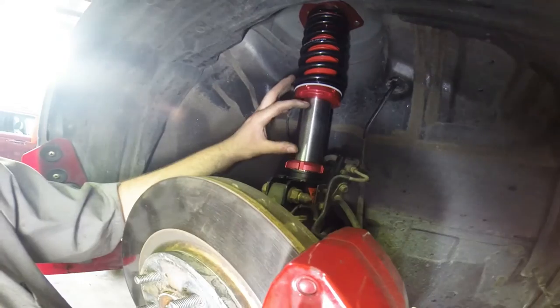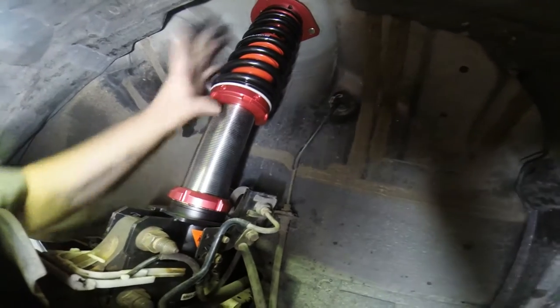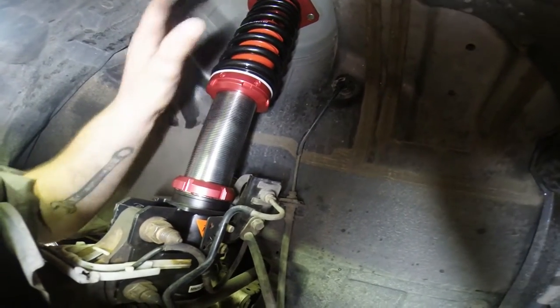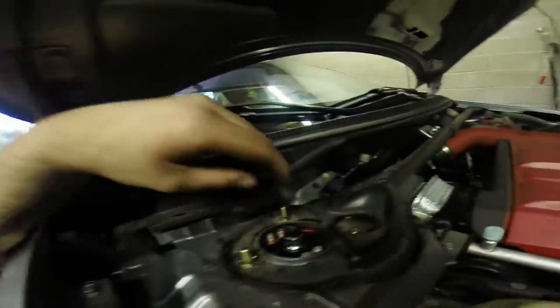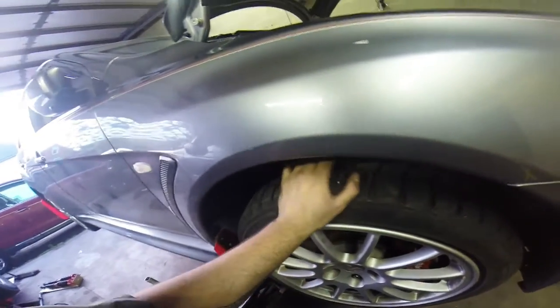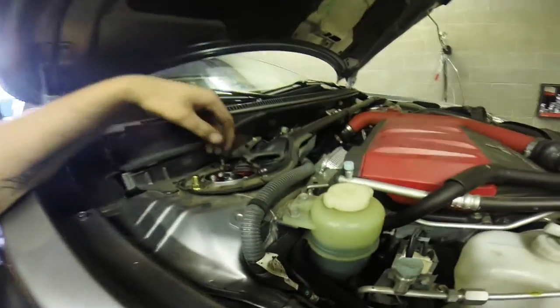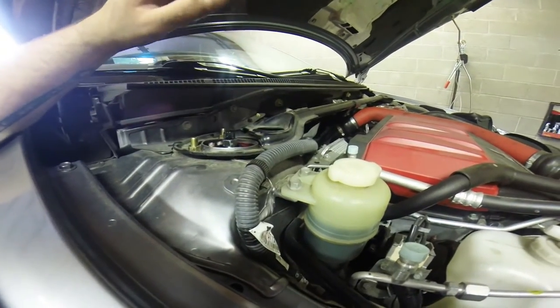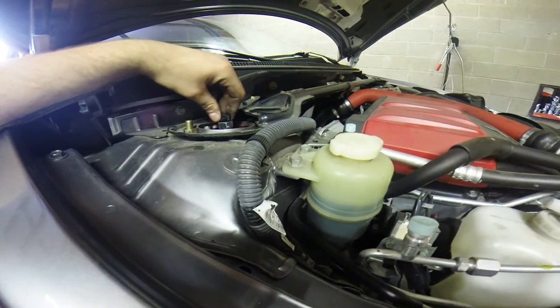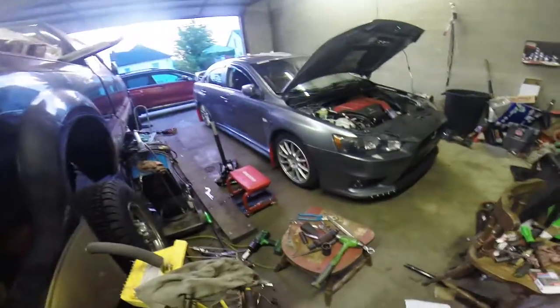Take these two bolts out, loosen our lock ring, and we're going to spin this up and shorten this gap. I don't want to play with the preload up here because this changes spring rate and spring travel — I want to keep this the same and lock it down. I'm going to come up to this top strut plate, loosen these four lock nuts, and pull on this wheel all the way out — try to bring that out — because it was really sitting underneath there. These four allen keys — there's an allen key provided in the kit — right at about 27.